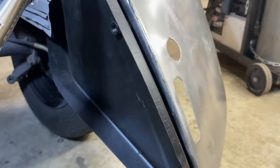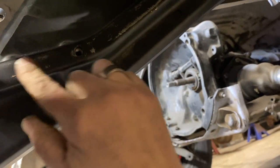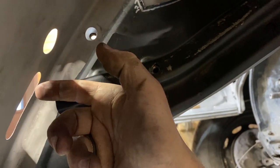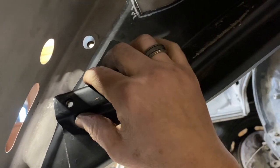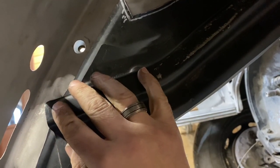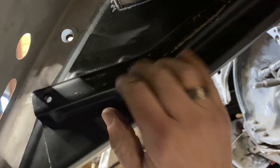The second thing we'll then do, at least our plan now, sorry, my flashlight turned off, is we will rework this brace with these two welded nuts if we have to, to get the bumper bracket perfectly lined through this slot. We need to cut this, twist it, angle it, re-weld it, so that the correct stock bumper bracket bolts right in here, and it doesn't need to be bent or twisted. The bumper sits straight. And I think that will be our second solution, but we're gonna do that after we get this piece in place.